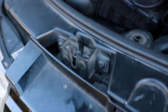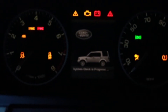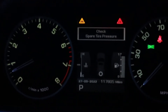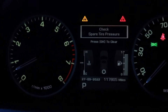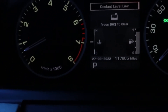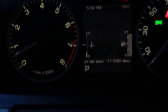Took my wire off and got my old part. So I'm going to shut the hood and see if it is fixed. Let's start her up. Coolant level low. Check spare tire pressure. And that's it — which in this case means it is good. I've still got to do the coolant level low fix; I'll do that on another video. But it did say hood latch open before, and you can clear your code with OK. So it's working.